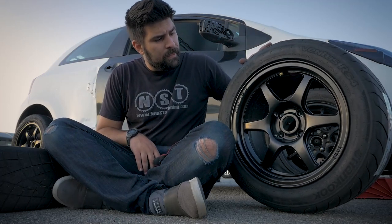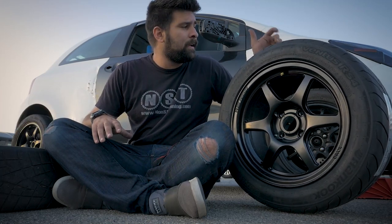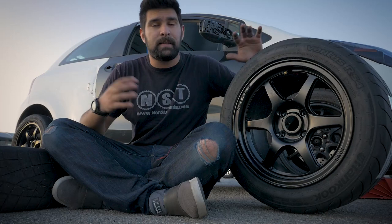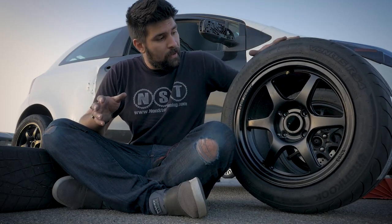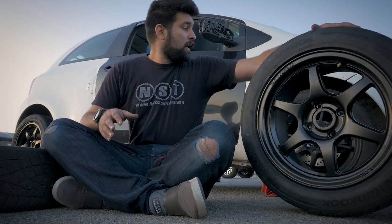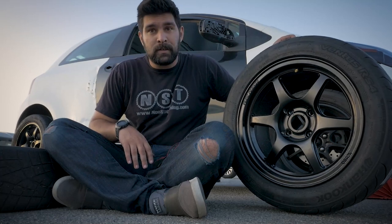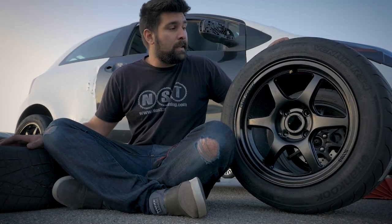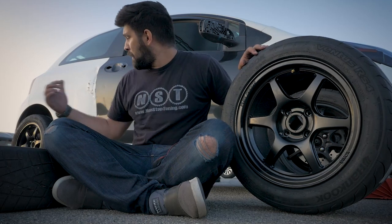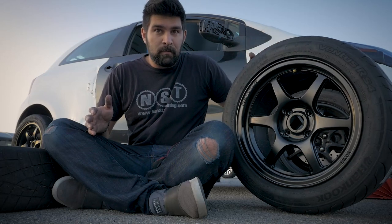There's a lot more information on these new tires and a lot more people running them, even at this event. If I'm feeling something weird I can talk to someone running the same tires and ask why it takes two or three laps to warm up. Either way I should have more contact patch and more grip. I hadn't even had a chance to put them on the car until now and it looks like they clear. I had five millimeter spacers with these wheels — I might keep them on the front in case of rubbing but I took them off the back. We've got a track day tomorrow; we'll see how it all goes.